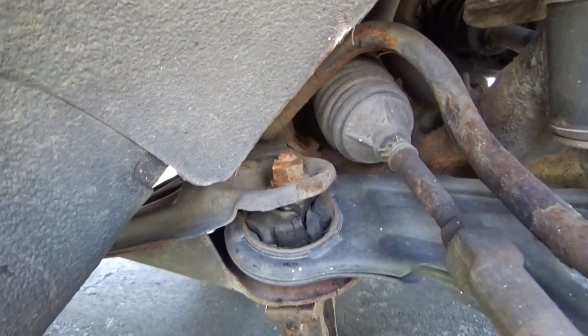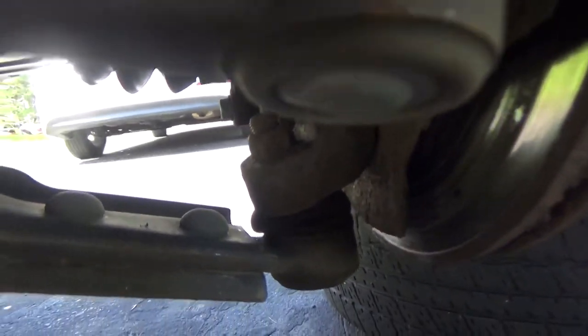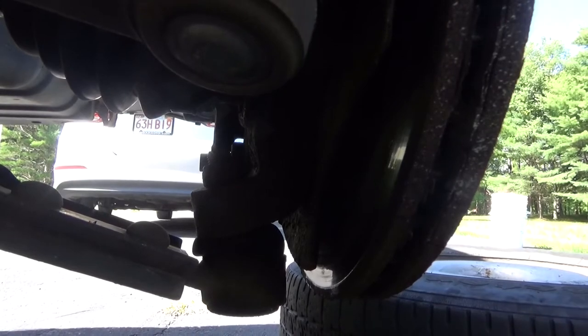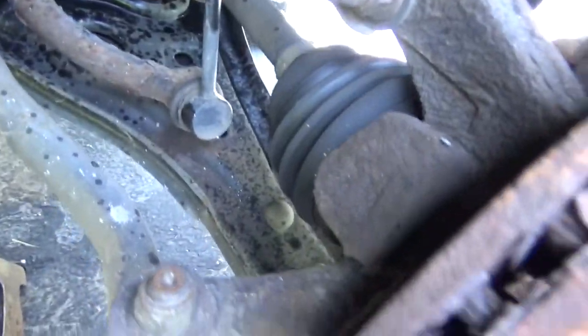That control arm bushing is shot, so the control arm needs to be replaced. That lower ball joint is shot. That needs to be replaced. Yeah, you can see the movement on the camera. Well, this looks like a little bit of a different mess. So, we don't need to be replacing a caliper. There's nothing wrong with the caliper. And the reason for his front end dive off to the side that he was talking about was all because of that control arm right there and this lower ball joint.